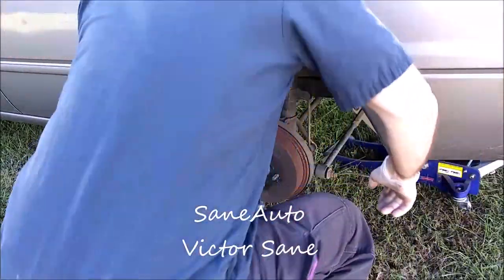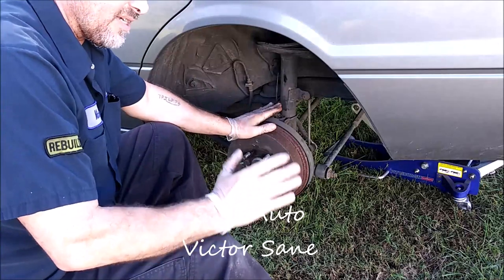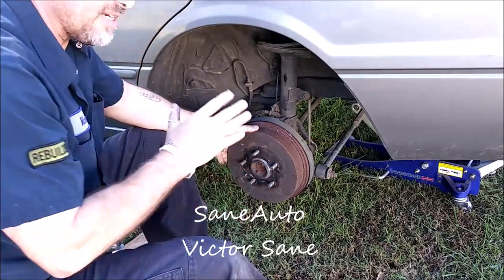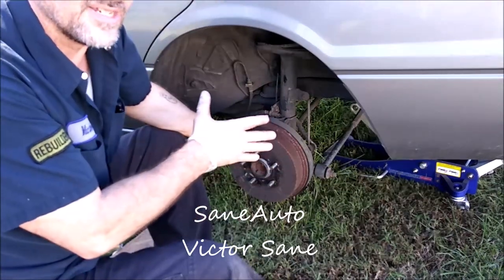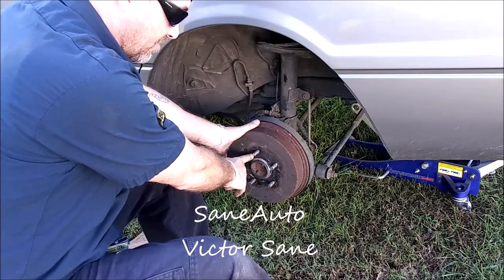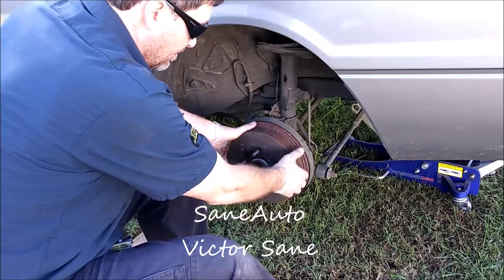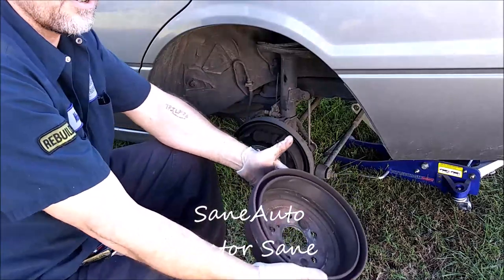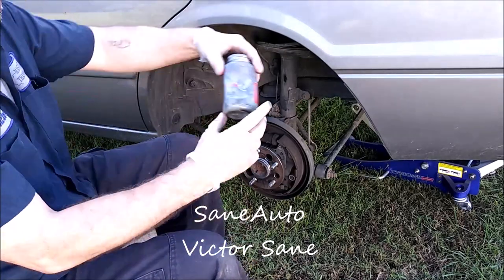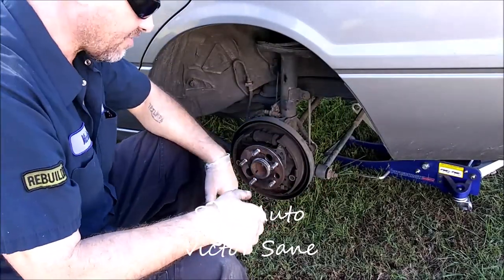Now, sometimes, if somebody like me hasn't already been in here, you may have trouble getting this drum off. And if you do, there are little holes right here that are threaded. If you look at my video on how to do drum brakes on one of these Toyotas, you'll see I show how to get these drums off by putting the bolt in here, tapping on it with a hammer to get it broken loose, and tighten the screw and tap on it and tighten the screw. But this is going to come off so easily because I've been here before, and you can see a little bit of anti-seize, which will also be in the link in the description. And anti-seize makes everything so much easier.